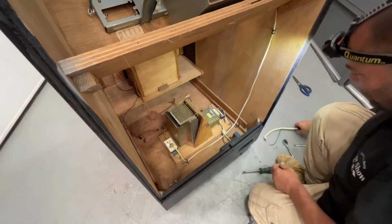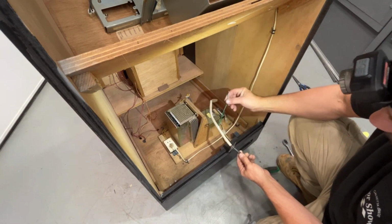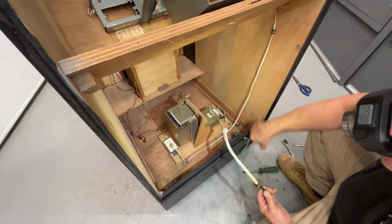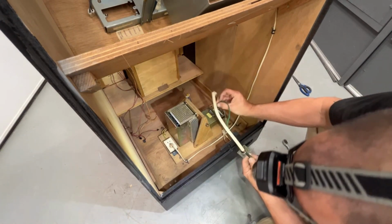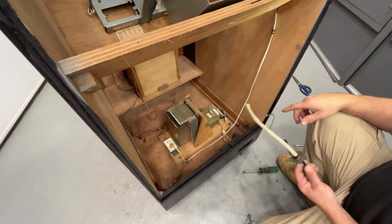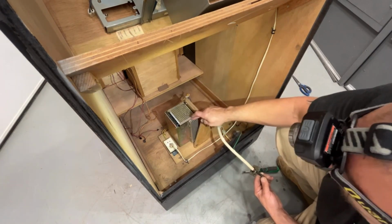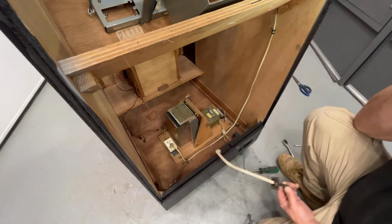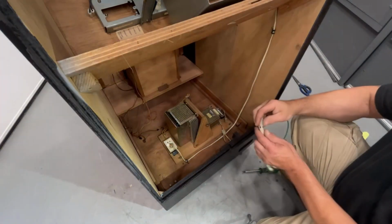Okay, now when this wire goes through the cabinet here, we've got to make a new cord. This ground wire right here goes onto a lug. There's a metal lug on the back of this switching plate that gets a nut put on it, and that's where this goes to. And then there's a bunch of green wires that are basically going to jump from there to here to the power supply, to the PCB, to the coin door, to the control panel. But I'm probably going to leave that out and let him put those on, because I don't know exactly how he wants to route those.